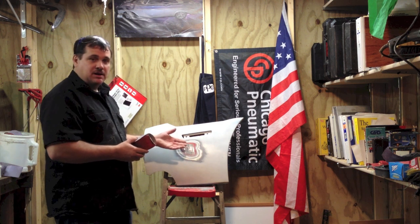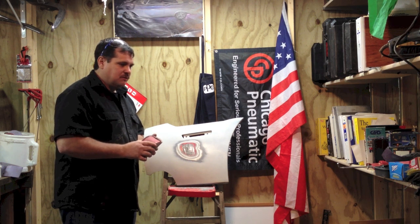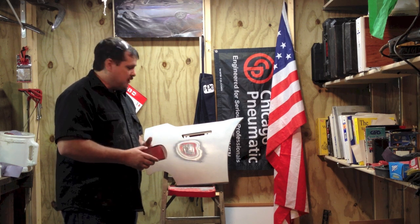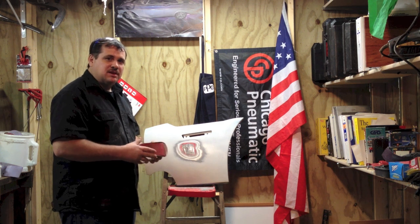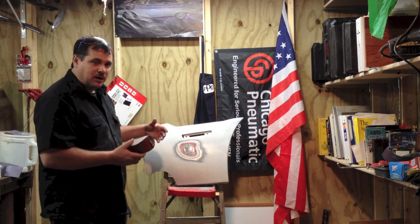Now, the products I use, 3M, now that's obviously not the only one. There's some other ones out there. I know Lord Fusor makes plastic repair products, and there's other ones too. But don't use Bondo or body filler for this. This plastic adhesive, it's going to stick well. It's going to adhere better, not come off later. So be sure that you use the right products, whatever brand it is.